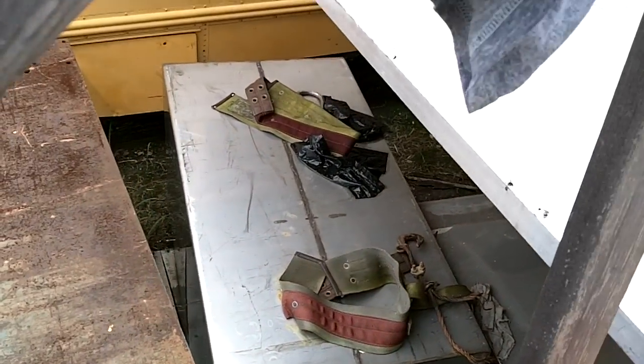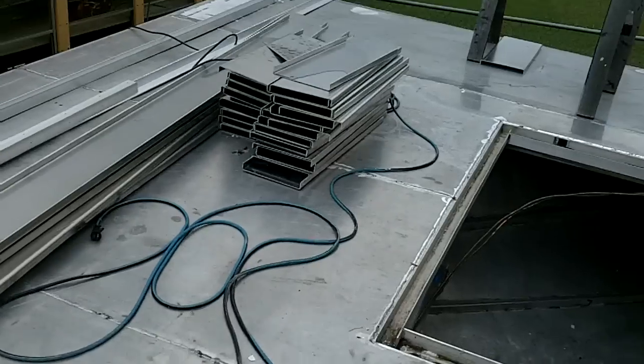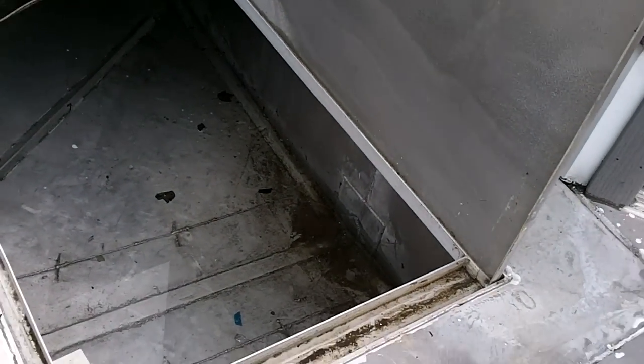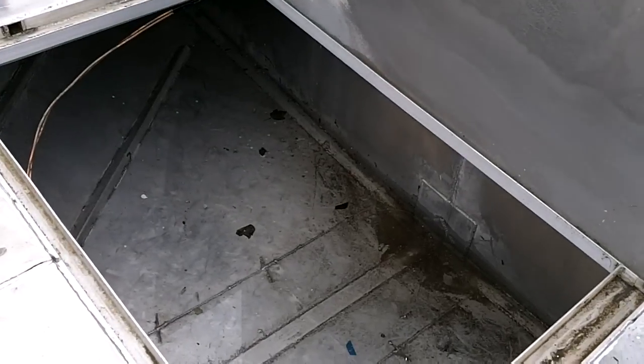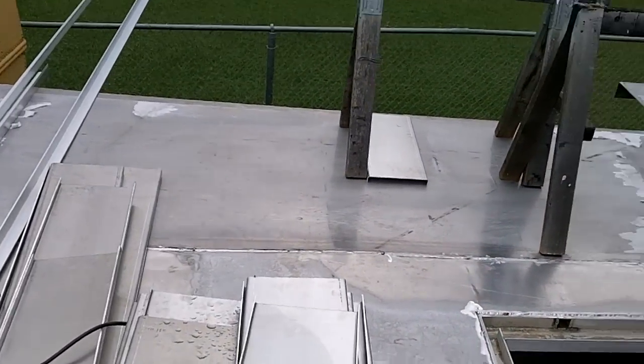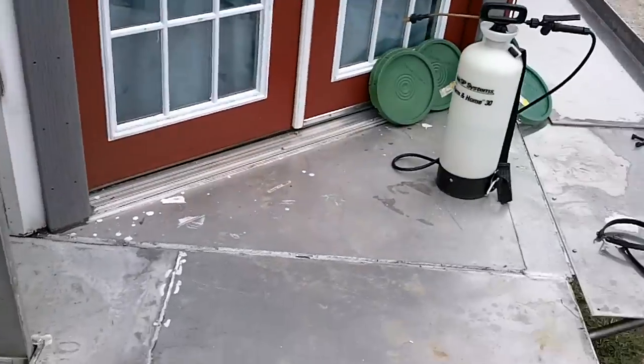That's the fuel tank — hadn't got it in yet. This is the front deck by the boat. This is the access port; that's where the fuel tank will be. I did not want the fuel tank inside the living area in case there ever is a fuel leak — you'd have to smell the fuel and whatnot. It's just a whole lot easier to put it up front. Have to do a little bit of playing around with some water in the water tanks to help with the ballast of the boat when it changes.